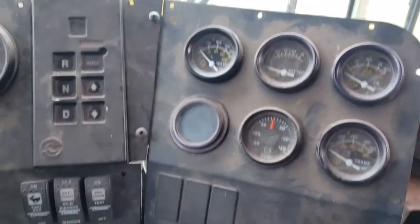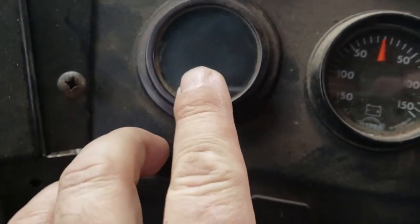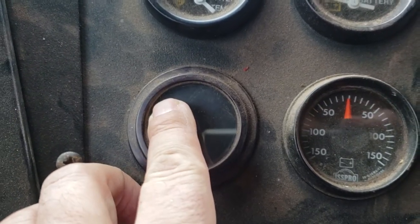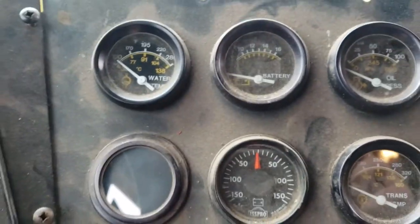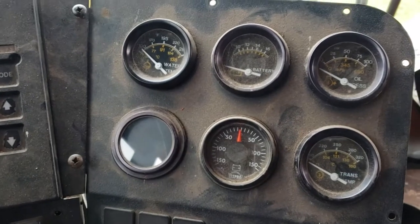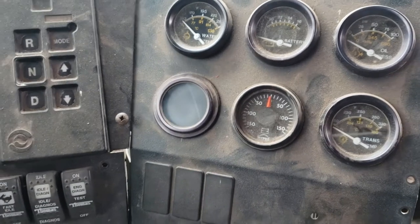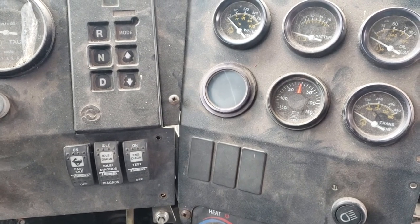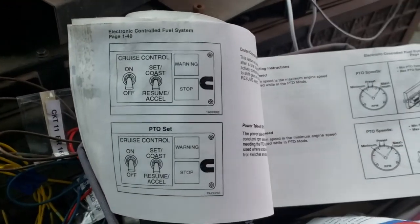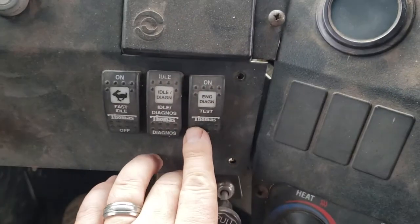There's a yellow warning light staying on in the top left corner here — this is called the pilot gauge, basically where the bus engine gives you warnings or a red light that says shut down, tied into the engine control module. This is the first time I'm going to try to read a diagnostic code using the flashers. In this manual for the Cummins ISC engine it's telling me how to do this. This is the engine diagnostic test switch which I'm going to put in the on position.